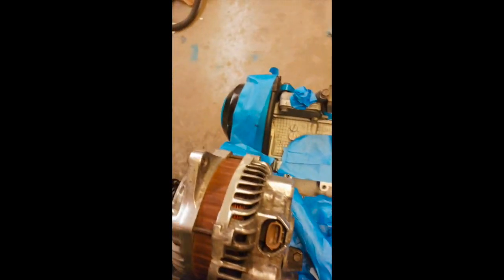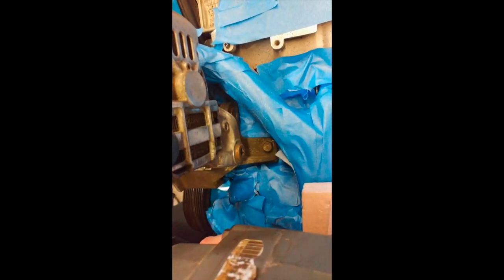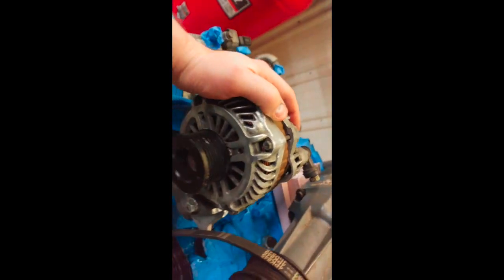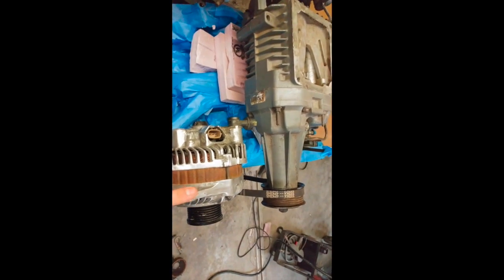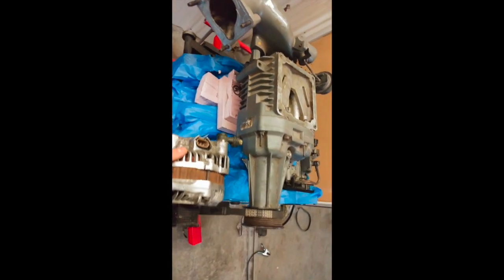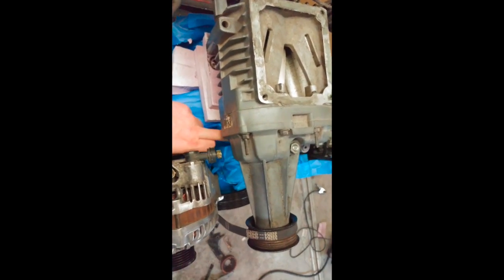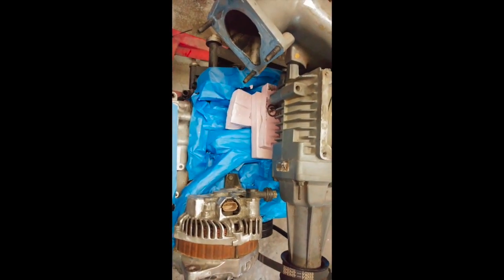I'm also going to have to bring that over to the back ear of this alternator. There's also a matter of possibly installing an ear for the other side. As of right now, the alternator is just mounted in with one bolt — it's pretty solid when I'm moving the whole motor, but obviously it would pivot, so that's going to need to be addressed. We'll bring an L-bracket in from over here, catch the bolt, bring that over and possibly brace that down. That way it's not just the one point — it'll be braced up there, leaving plenty of room for the hoses and everything.